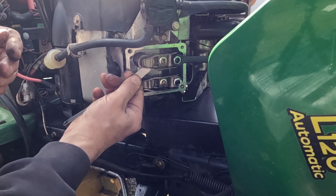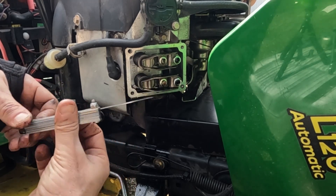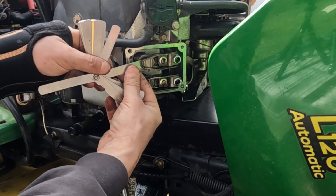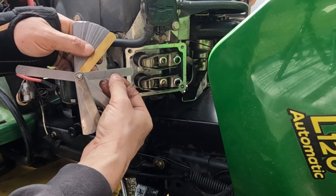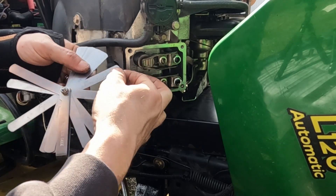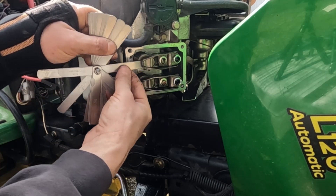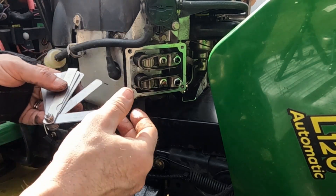Let's see what we've got — put it in there. Seven goes in, eight, nine, ten, eleven — starting to get a little snug. Twelve, let's skip to 14 — 14 gets in there. 15 feels about tight. So what we really want is for 6 thousandths to be snug, but right now we're way past that — we're going to have to adjust.